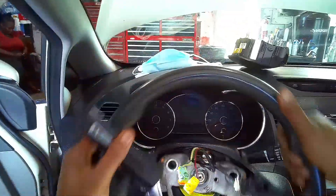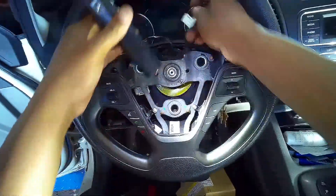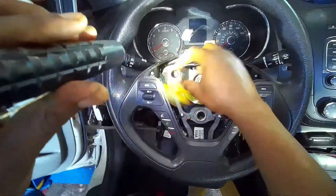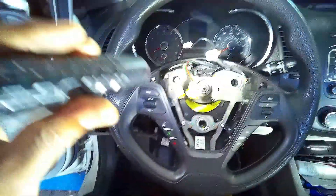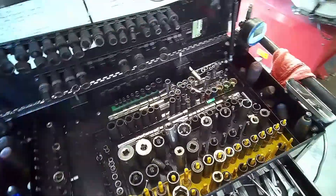I'm going to turn the steering wheel back and make sure my wheel is straight. I disconnect this right here — got it out. This is going to stay with the clock spring. This nut is a 21 millimeter, so I'm going to make sure that my wheel is straight. I'll take an impact gun with a 21 millimeter socket. I already got it loose.